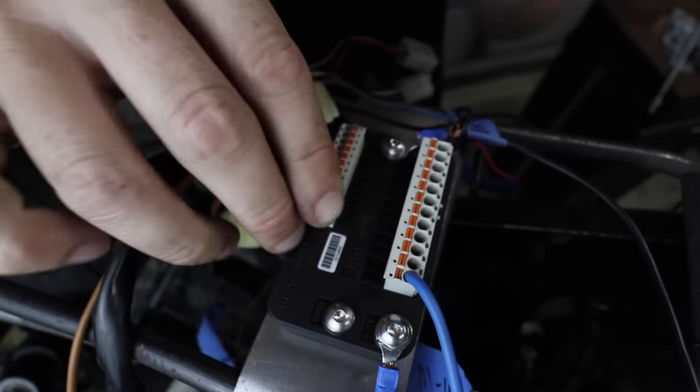Step six: I'm just using a jump pack at the moment — that battery was for demonstration purposes. All the wiring is rough and ready, everything's in place. I'm using the original key ignition as my key switch and a temporary start button, everything wired in its location as explained in the diagram. There's no fuel or exhaust on the bike at the moment so it won't fire up — I just want it to turn over to show you.